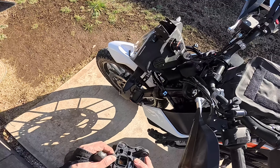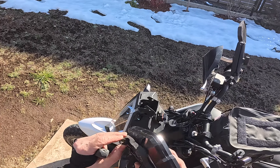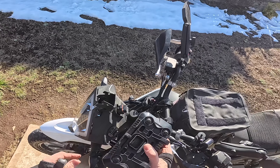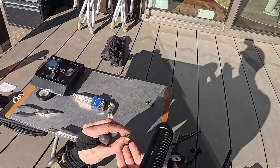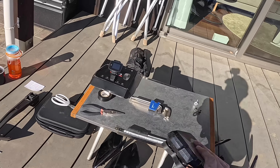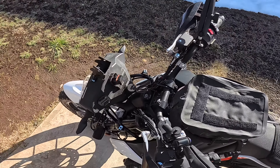So what I had to do is I had to get a drill, drill straight through the head of that bolt until it came loose. Pulled everything out and ended up damaging this part right here. So I had to remake it. I went to the store and found one of these little grommet things that are supposed to actually be used on electrical wires, but it works great. It is a piece of rubber in there so it definitely has some padding. And it's a lot more solid than that flimsy teeny tiny little bolt that sits on there originally. I don't recommend you breaking this and doing that — this is just something I had to do to get this thing to work again so it wasn't flopping all over the place.